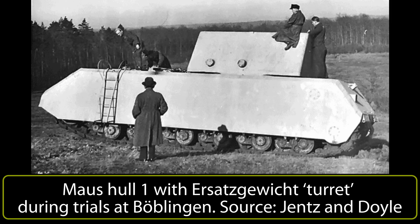After that, it undertook its first successful trial and was then back on trial on 31st January. During this test, the first problem was found. The rubber rings within the wheels, something which had already been identified as a weak point, started to fail under the load after just a 14km journey, of which the 9.4km on a hard surface were likely responsible.